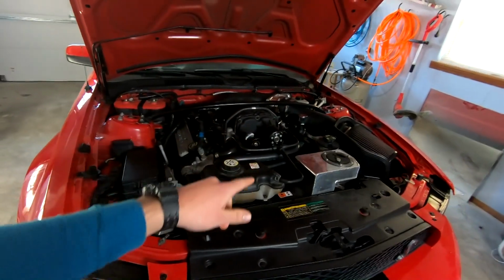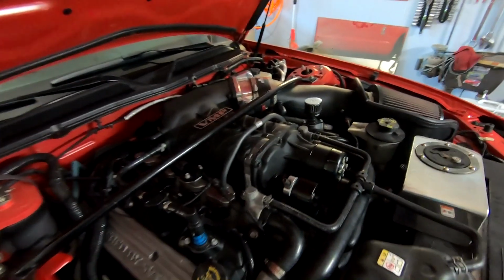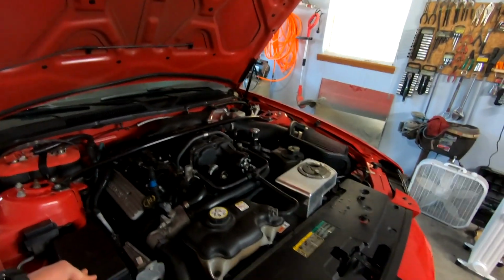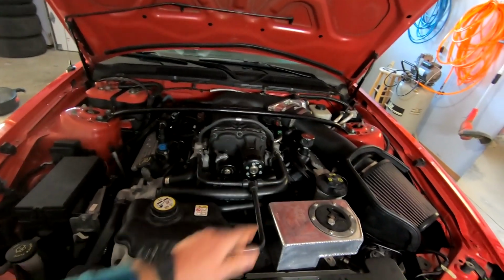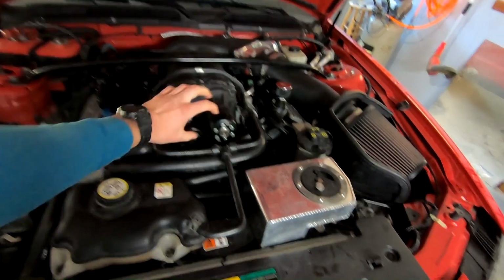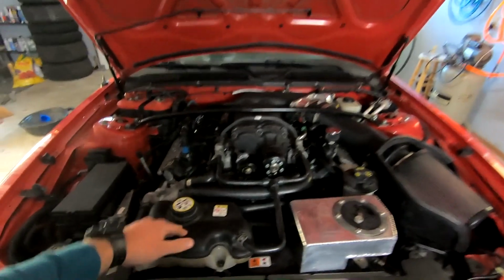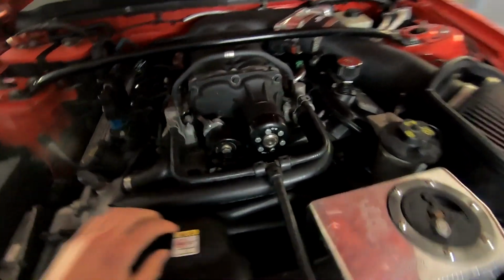Next thing, the VMP 2.8 pulley. I ordered a hub spacer from them, a 2.4 millimeter hub spacer. Right now it is properly aligned-ish. I took the washers on the front side of these, flipped them to the back side of the pulley, carefully lined it up and put it on, because when I was running the last clip, one thing I was looking at, the belt was trying to skip about a full rib length up onto the side of the pulley. So that's obviously not good.